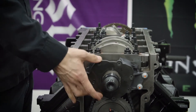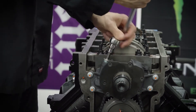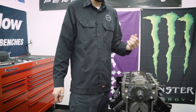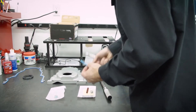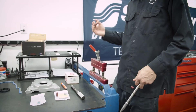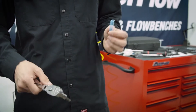Since we're going to run a standard pressure high volume on this application, we're going to remove this plug here. Inside this void is a spring, and that's what controls our pressure relief valve. For the Melling high volume pumps, it will always come with the red spring installed. So we're going to take that one out and install the blue spring. The blue spring is standard pressure but still high volume. You can also do the silver gray spring, which is the extra high pressure system, but we don't typically need that for this application — it's a mild build and we want good volume pressure, but not necessarily high pressure.